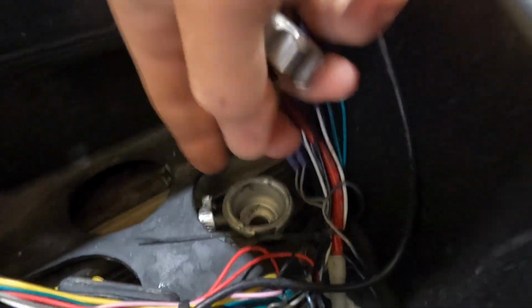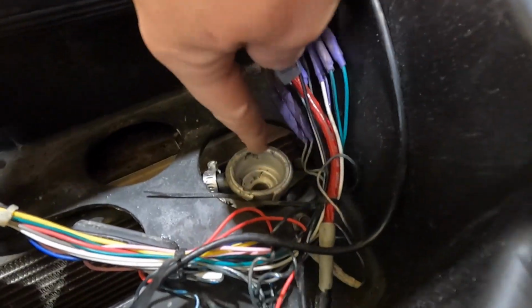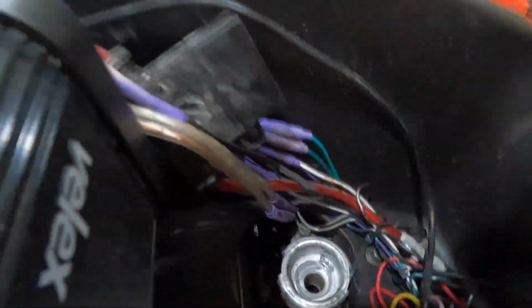Also, now I run across this after cleaning, because yesterday after warming it up and everything, I thought the radiator cap wasn't sealing right. So here's what I ran across now. I cleaned it all up. I don't know if you guys can see this or not. There's holes eating through there, all over this thing. It's all just because it's sat, and who knows what else is going to happen to this thing.